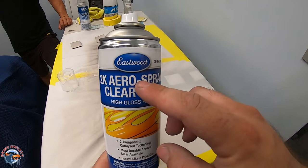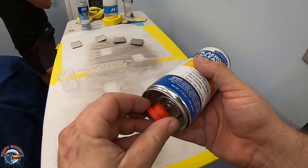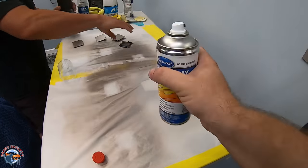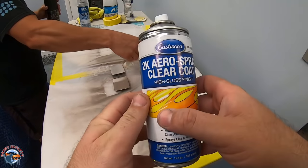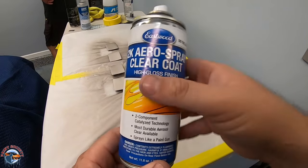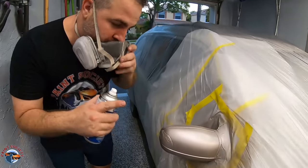This is the 2K clear coat we're going to use — Eastwood makes it as well as SprayMax. This little cap, once you put it on the stem, punctures the bladder and releases the catalyst. Once the catalyst and clear coat combine you have a real clear coat, just like out of a gun. It takes a bit of force — put it on something hard to break the bladder. Give it a good shake for a couple of minutes to thoroughly mix. Once you start shaking it there is a pot life — maybe a day before it starts to gel, but do everything in one setting. Make sure you have a mask because this stuff is hazardous. We're going to do about two coats, maybe five minutes between coats. First coat won't go on too heavy.